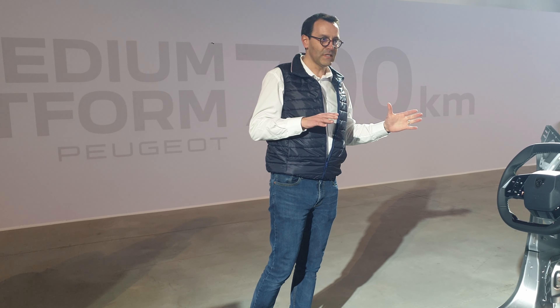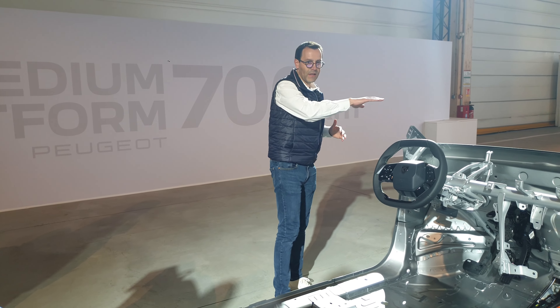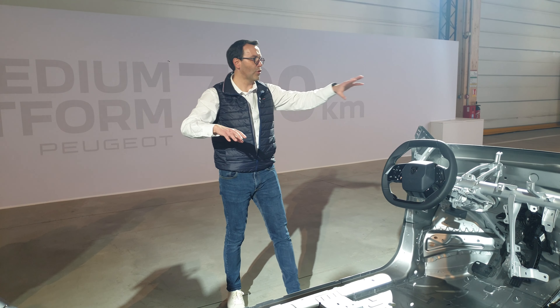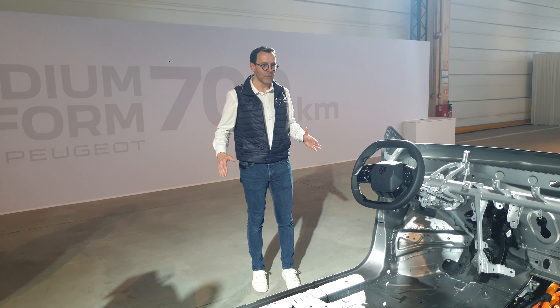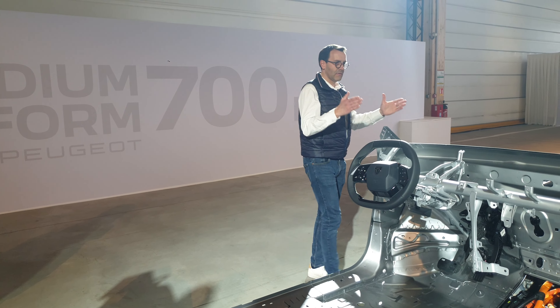To detail what is specific and what is common: when we speak about platform, it's everything in front of you except the propulsion system and battery — everything that integrates the propulsion system into the battery. Between the front panel and the front, we have something standard for every energy. PHEV, MHEV, and BEV will share the same front unit. But starting from this front panel, the rear axle is everything dedicated to BEV. This time, we started designing this platform as BEV-native and then adapted it to other energies — the opposite of the first story of BEV for Peugeot, which started from multi-energy platforms and switched to BEV adaptations.